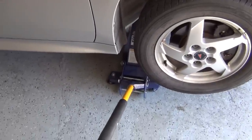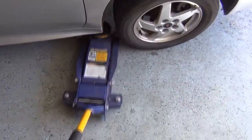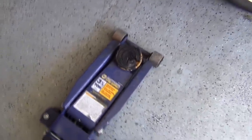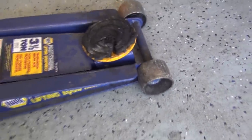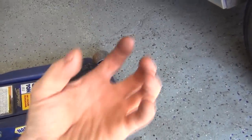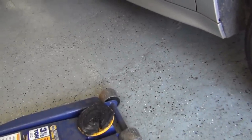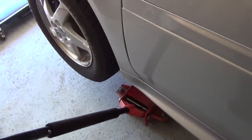You notice this one's not rolling but the other one is rolling. What's nice is because it's a cup on that part that I showed you, it's not going to go anywhere. But the bigger the wheels on the jack, the easier it slides. If it won't slide and the car's coming down and it's metal to metal on something smooth, it'll slip off that strong point onto something like a floor pan and put a big dent in your floor board. So you want to make sure that the jack can roll - if you buy a good jack with bigger wheels, you're a lot better off.